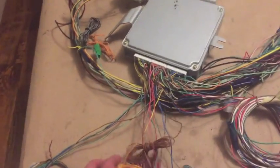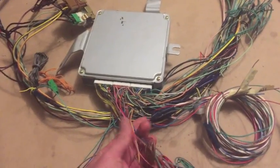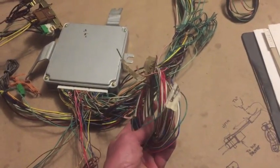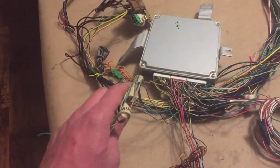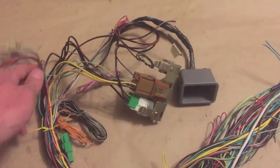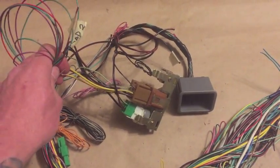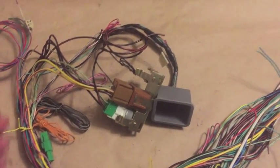When you're doing your identification, grab yourself a pinout — it looks kind of like this. That's the connectors and the legend. I'll have a link in the description to the resource page on my website where you'll be able to find it. Next I'm going to pull these out of the ECU connectors and route them toward the engine connectors. The fuel tank wires are cleaned up, and we have a couple of wires going up to where the relays and OBD2 connector are — radiator fan high and low, as well as the check engine lamp, which I like to put right near the ECU.